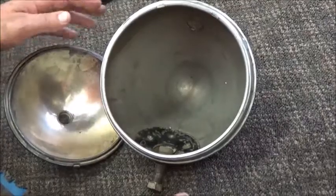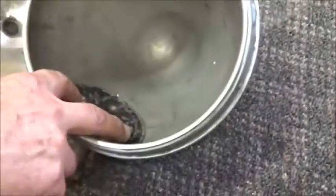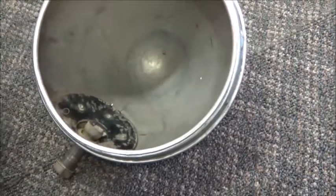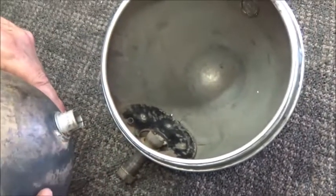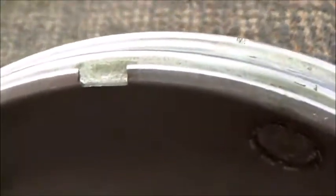So just to walk through that briefly, first thing you want to make sure you've got the King of the Road medallion finalized. That's in there. Your base is all finalized. You've got the car wired into the back of the reflector, which we showed previously. And then you want to orient the reflector on the headlamp using a locator tab. It's kind of a protrusion here, and that fits into the slot on the headlamp itself.